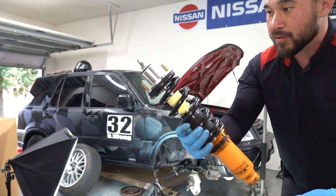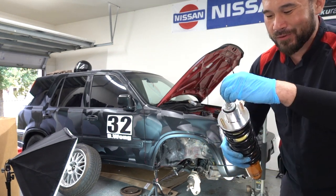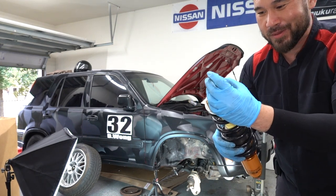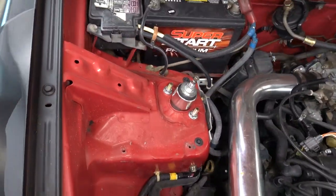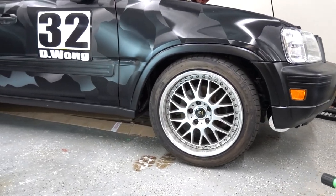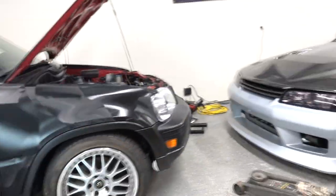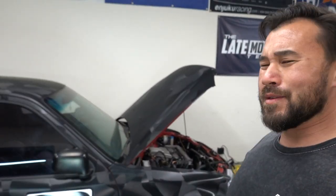Top hat installed. I feel kind of bad I broke the adjuster, but it's set on full hard anyway — that's probably where I'll leave it. You can still kind of adjust it if you stick it back in there. Coilovers back in — you can see how high the extended hats sit. Looks a lot better. Should ride better now that it's actually riding on springs at this height. To get it any lower you'd have to start maxing it out again, but Max Speeding Rods — it's gonna have to work for now. See you guys in the next video.